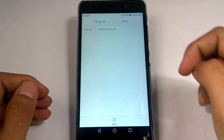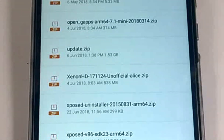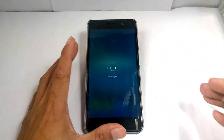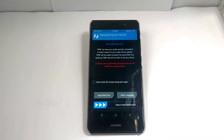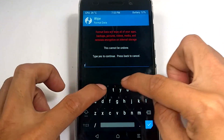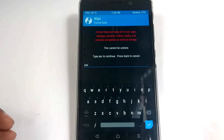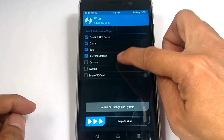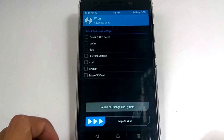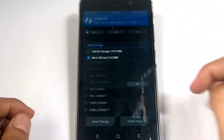Copy the file into your SD card or directly download the file from your device. Here's the Xenon HD custom ROM and the Open GApps 7.1 mini. Then let's flash this using our TWRP custom recovery. Hit the wipe, format data, and type yes. Then let's go back to advanced wipe.